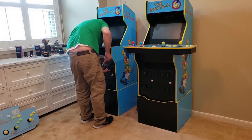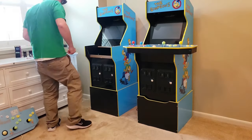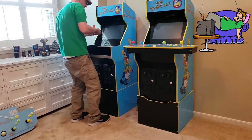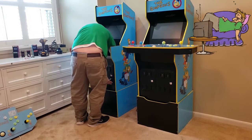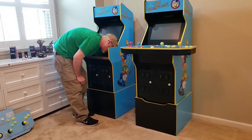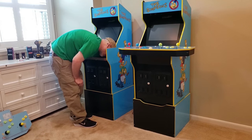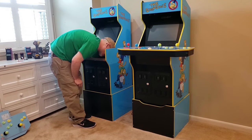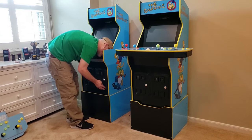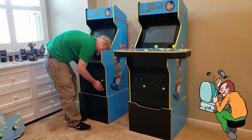This let me spread the front of the cab enough that I was able to separate the front top panel from the cab without needing to disassemble the full cab — and that's kind of nice as I'm kind of lazy and this is the weekend. After removing the control deck and the small top front panel, I'll start to remove all of the screws and the plastic caps that work together to hold the coin door in, and I'm going to attempt to make this repair without fully removing the front panel. I'm not so worried about removing these screws and plastic caps, but I am worried about getting them back on.